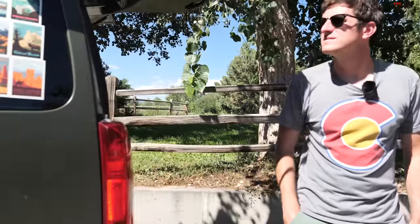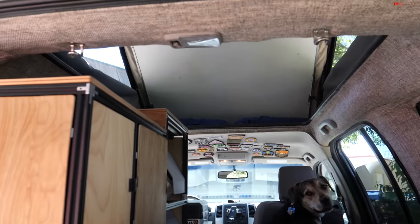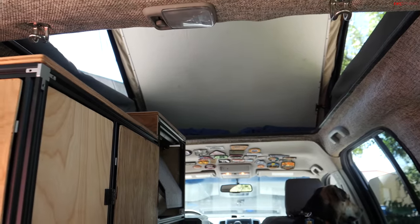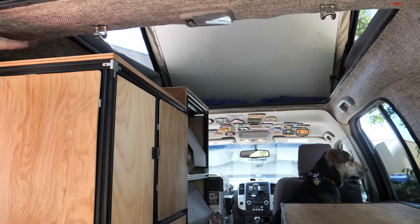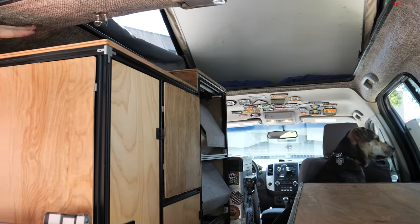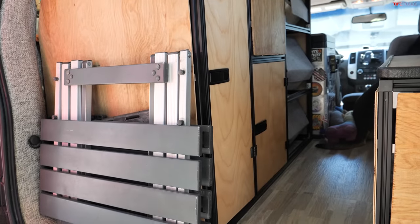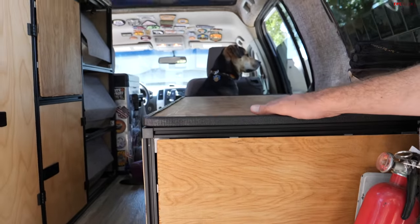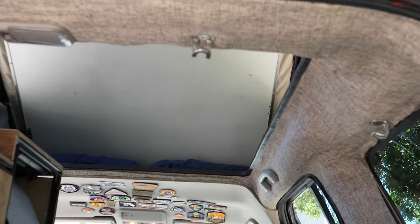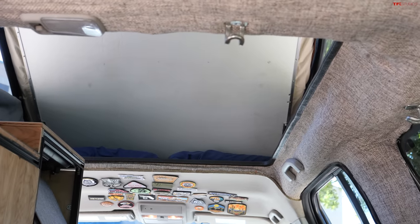To keep it watertight, I used truck camper topper foam in between them. The Nissan Xterra comes with a stock rack that has about 36 riveted bolts, and I essentially used every single one of those bolts, plus added about six more rivnuts. It's all bolted down through rivnuts. It's been about three months with this style of build and we've had no issues with water — it's been super tight. I cut the hole and married them together in 10 days, right before Expo West.